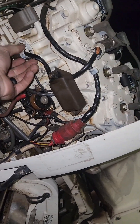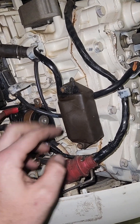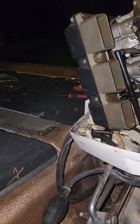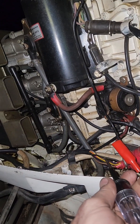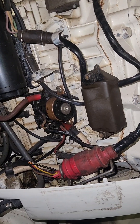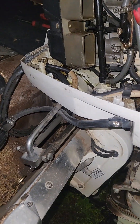So this is the power pack — basically the BCM. If you're having similar problems, there are a couple of ways to test this. It could either be your ignition switch or it could be this power pack. One way to test it is to find this black with yellow stripe wire that comes into your control harness. You can see there's a little nick in the insulation because I took a test light to probe it. I found a good grounded bolt and jammed it up under the jacket to make a connection. That made the engine sputter just like the key did, but it wouldn't kill it. I've been having to use the primer lever to choke this thing out because otherwise it'd just sit there and run, and it doesn't have a fuel shutoff right now, which is an issue I'm going to have to correct.